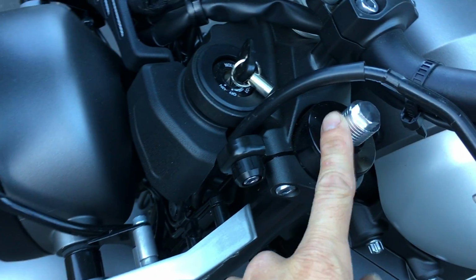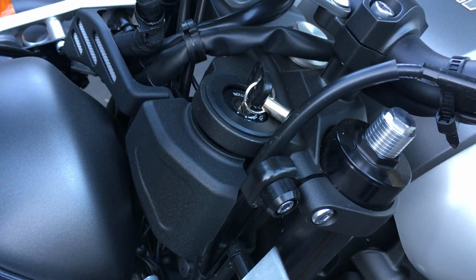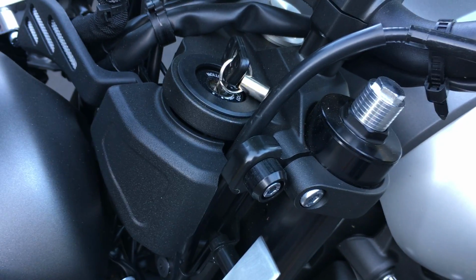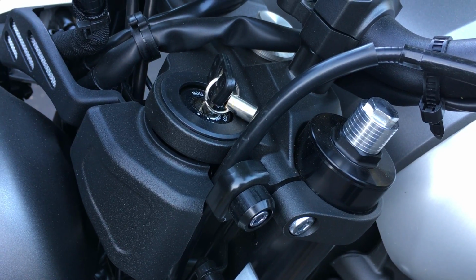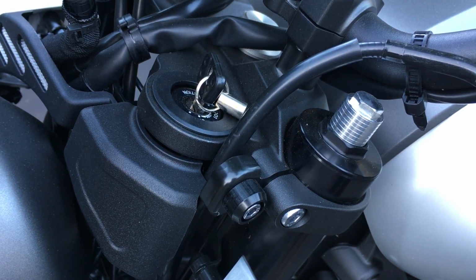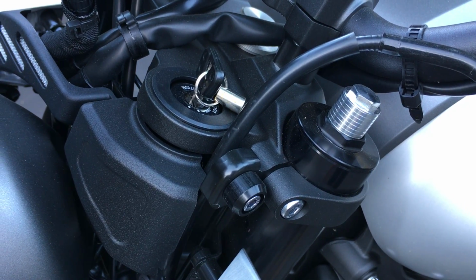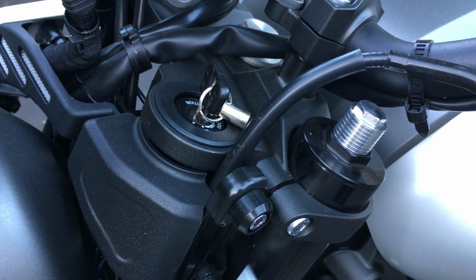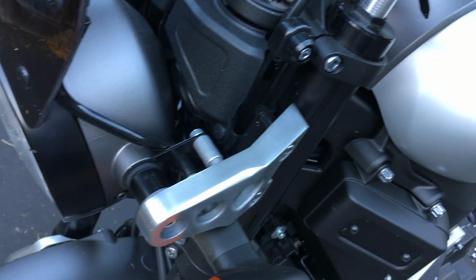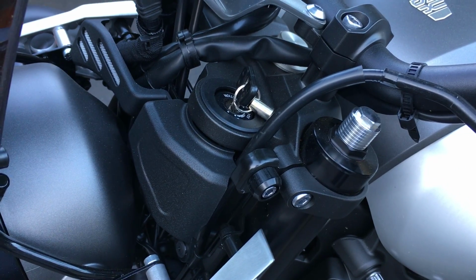I also have to double check my preload and the sag after a little while, because when the suspension breaks in, it changes a little bit. So you have to come back to this when it's more worn in. I would say probably about 3,000 miles. Usually, I find that suspension fully breaks in around there or a little past there. The first 1,000 miles, you feel it the most different, from 0 miles to the first 1,000. After that, the difference is less and less. But usually around 3,000 or so miles is when it fully breaks in, sometimes a little more. So that's how you adjust your suspension, or front fork anyway. I'm going to do the rear in a separate video. Thanks for watching.